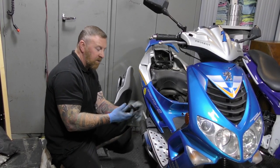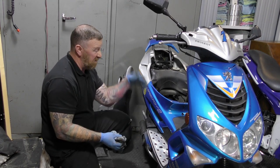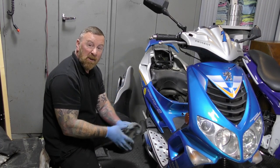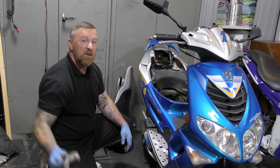Hi, Mark Savage here, welcome. I wasn't going to show you a video of me changing the exhaust because it isn't hard. Bucket out has three bolts, two head bolts out — remember they're 10 mil, WD or maintenance spray — and then two bolts at the side here. Nothing major, and off comes the exhaust.